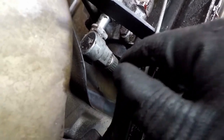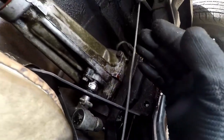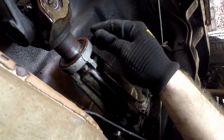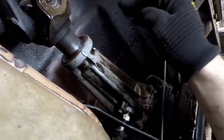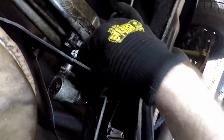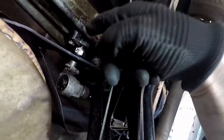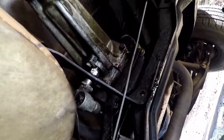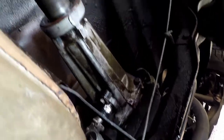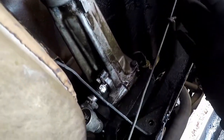All hooked back in, extended to the speed sensor here. As you see, we are leaking some transmission fluid pretty good. This seal looks new — I wouldn't condemn this seal yet — but we're definitely leaking out of this speedometer sensor spot, and probably other places as well. So I think that's going to be something I want to do in the future: replace the seal back here and clean up the other spots it's leaking from, because I don't want a leaky transmission, at least not when this truck works so good already.